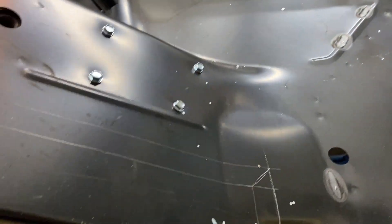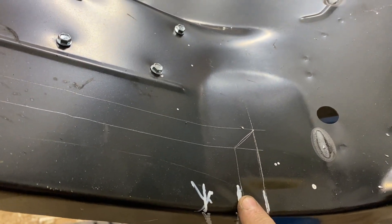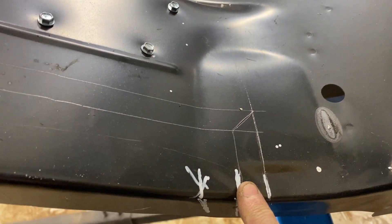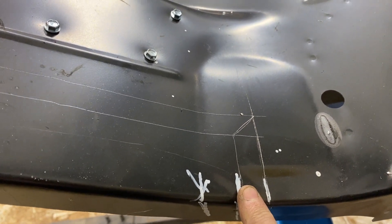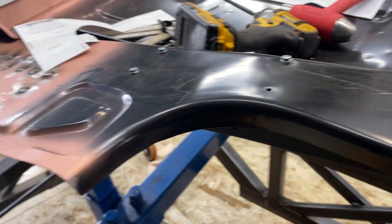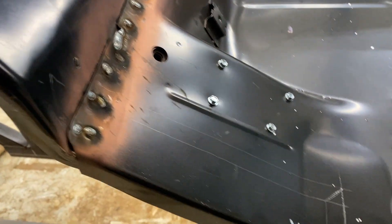I'm a little sketchy here — this is the back of my rocker surfaces. I might cheat that ahead just so I don't make a bad mistake and end up a little short. I can always trim more later. The big thing is to get this cut out up through here. I've drilled the spot welds out that are reinforcing the shock mount, and now it's time to get the grinder out and have at it.